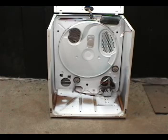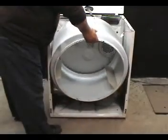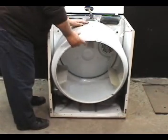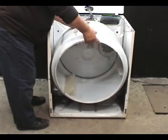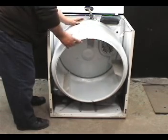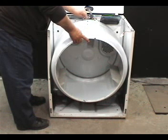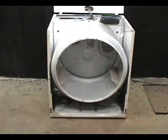Let me show you how to put it all back together the right way. Put the drum inside of the dryer on top of the drum rollers. Turn the drum around to make sure that the drum is riding on top of the rollers and the rollers are riding on the groove of the drum. Find the drum baffle screw that you loosened before and make sure it is on the top. Hook the coat hanger wire from the head of the screw to the hole on the back panel. This will hold the drum in place and make it easier to install the belt and the front panel.